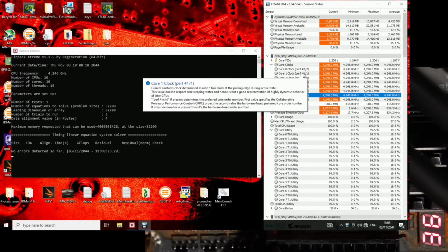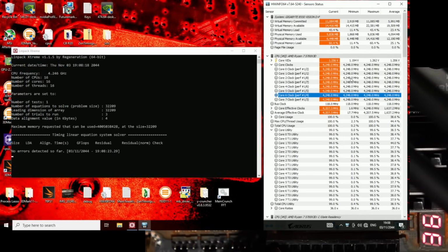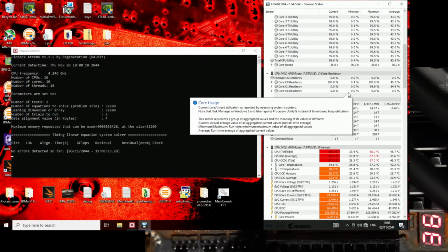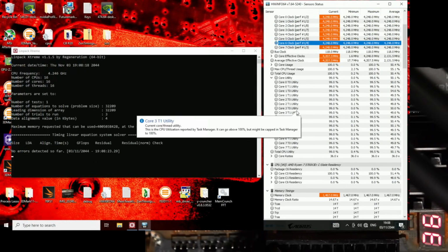And the sad thing is, you might be thinking, well, okay, if you can do this with this super janky custom P-state, disable all the PCIe, disable all the boost, this weird kind of static overclock setup, what about if you leave the boost algorithm enabled and then just try to raise the BCLK on top of that? Can you make single core frequencies hit, I don't know, 4.3, 4.4? And the answer is no, because like I mentioned earlier, if you just raise the BCLK with PBO enabled, at some point, actually not PBO, but just the precision boost algorithm, PB, it detects your BCLK overclock and drops itself to 3 gigahertz. Which is very, very helpful.